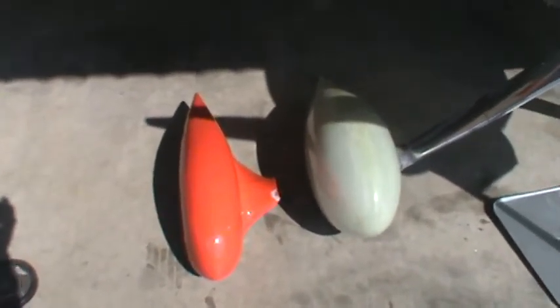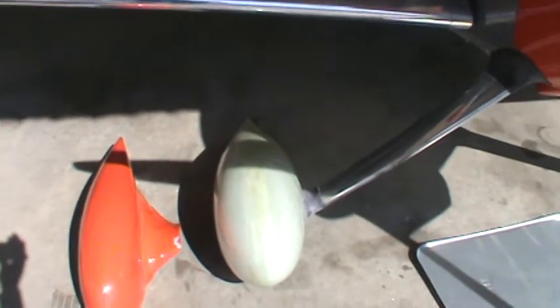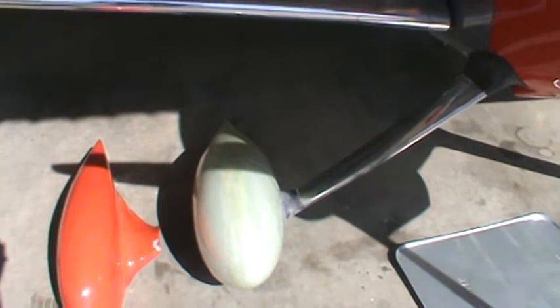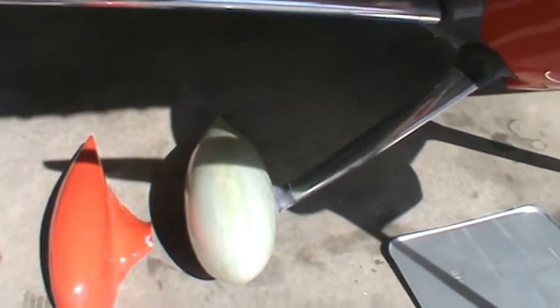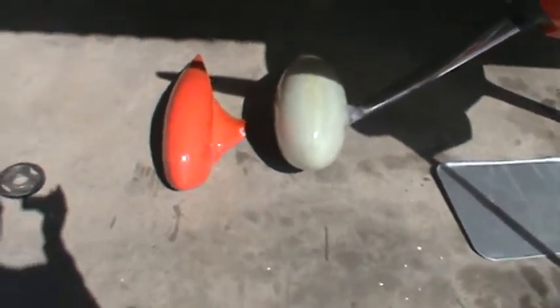The old wheel pant — it is thinner, but it is not less draggy. This big tuna wheel pant is so much easier to work on the brakes than the tires, because it splits right here. That forward part comes off, that fairing comes off, splits in the back and goes up. Just easy to work on, and due to that pressure-reducing shape, much more aerodynamic than the seemingly smaller wheel pant there.